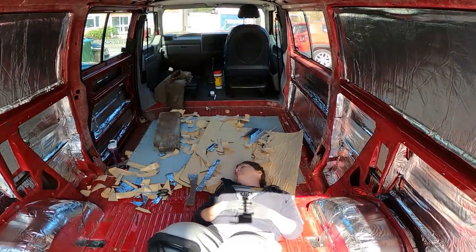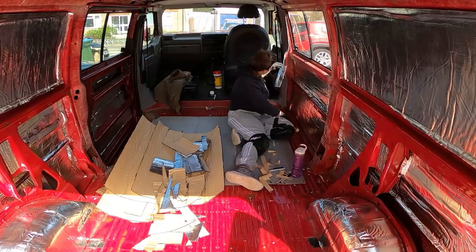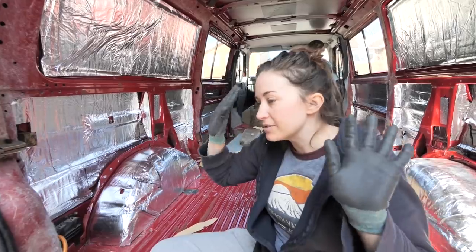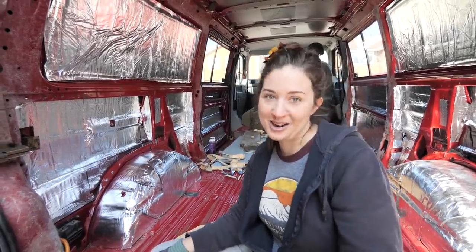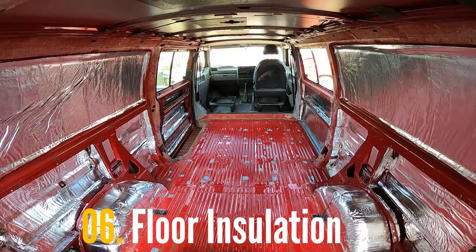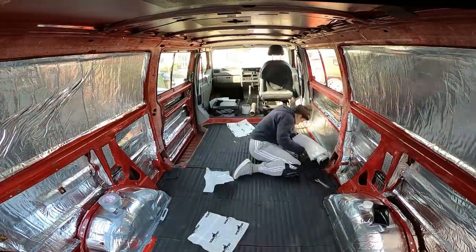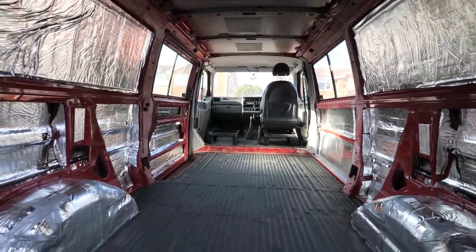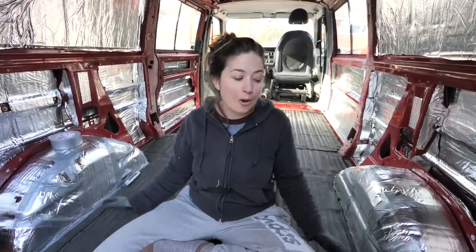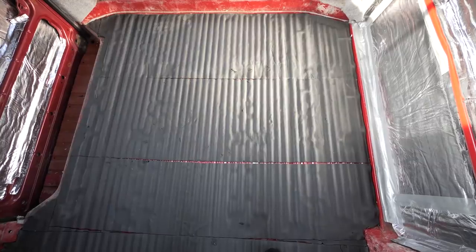Scrap everything I said before — I thought this was going to be really easy, just peel off the backing, stick it on, and it'll take an hour max. It took about five hours of sticking, cutting, resizing, and getting into all these little nooks, crannies, and crevices, which was a nightmare to say the least. So allow yourself plenty of time if you're doing something similar. Next up we have the flooring — I cleared everything out, gave the floor a wipe down, and started sticking. And like that, the floor insulation is done. It really wasn't that hard but it is tiring and time-consuming — it took me a whole afternoon.